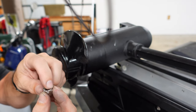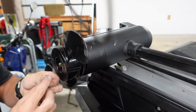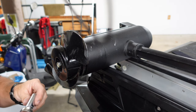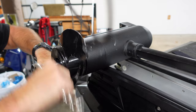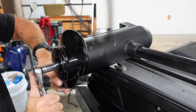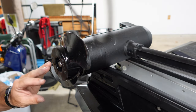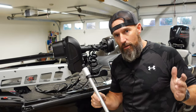Put that prop on — you gotta line it up, and you'll feel when it's lined up. Put the washer on and then the nut. Make sure when you put these nuts on, inside there you can see some white — that's the locking part of the nut and that's going to be facing you. You don't want to put them on backwards. Use your 9/16ths to tighten it up and you'll feel it bottom out. That pin is your shear pin — it's made to break before the motor breaks, just in case you hit something really hard.